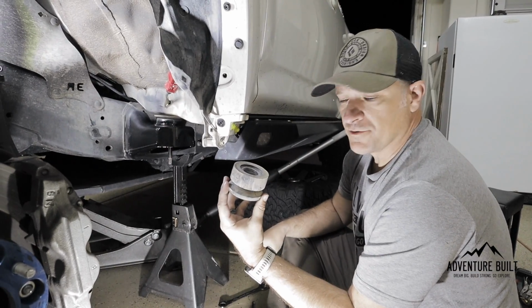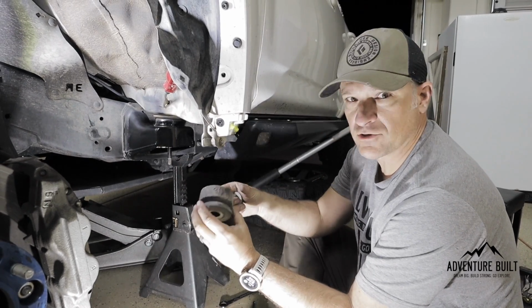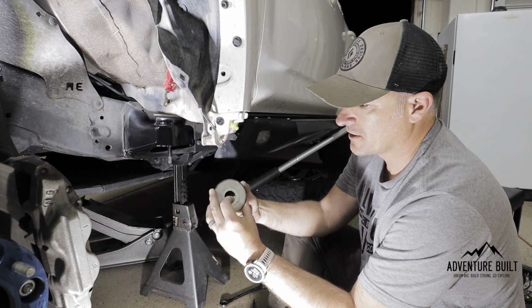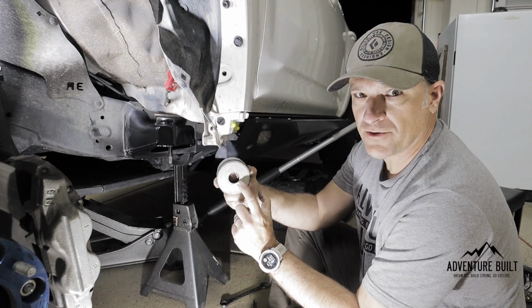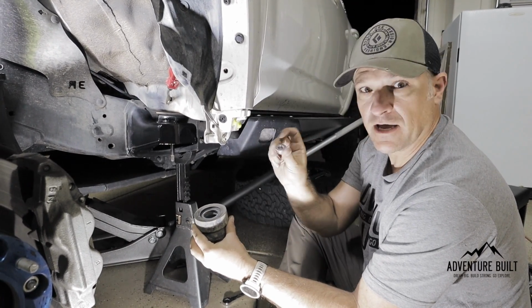Before we put the wheels and tires back on, we should probably put that bushing back in. So let's go ahead and do the bushing right now. When reinstalling the bushing, the large hole goes inside. There's metal sheathing around the bolt in there, and there's a metal washer on the bottom. Then the washer goes under that, and then the nut.